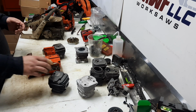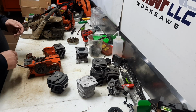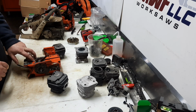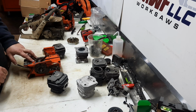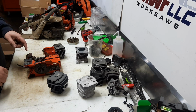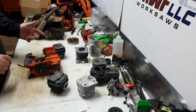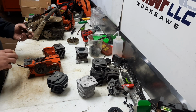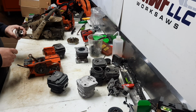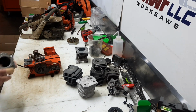I don't know, maybe we'll try going all the way to the 56 millimeter, see what that looks like. But I don't know if we'll push it that far. My main goal is going to be 3 cubic inch 50 cc fast. I want to blow our other race saw out of the water. Then, and I'll probably do these two at the same time, build a 3 cube and a 4 cube. But let me know which one you think, 36 by 48 or the long stroke and sleeve it. Probably going to go 36 stroke, 42 bore for our 50 cc.